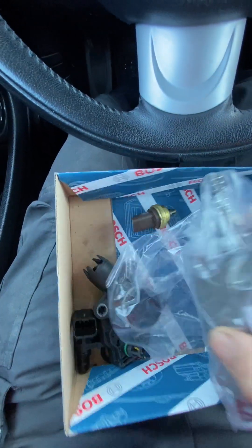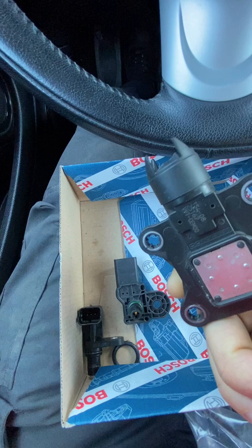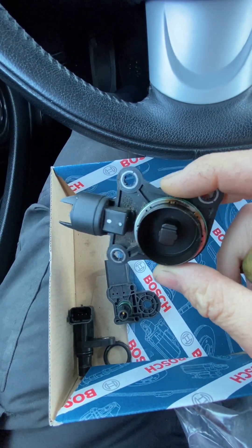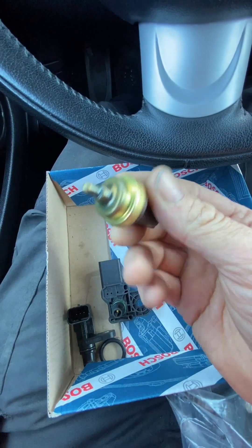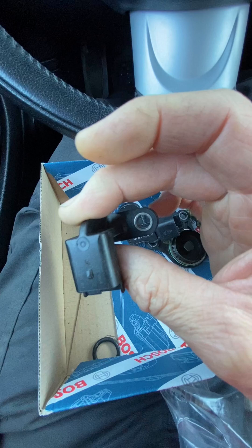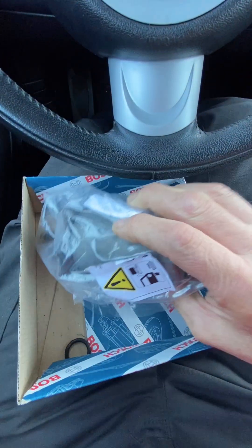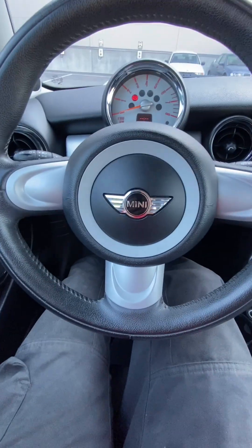This is not a joke — the car came to me today running on three cylinders on startup. This is what they've already changed trying to fix a misfire on startup: Valvetronic position sensor, coolant sensor, MAP sensor, camshaft position sensor, an O-ring, and a Valvetronic motor. So basically they've changed all this and I've got to work out why it's running on three. Let's check it out.